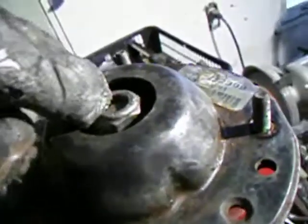Now you're faced with this silly problem that I don't know why car manufacturers do this, but GM's not alone. Here's the top of the strut mount. Get my light back. The top of the strut mount has this shoulder on it, so you can look down in this hole and see the nut that goes on the top of the strut shaft. Right there, it's loose now. I've got it all loosened off, just sitting there. You can see the nut, but it's recessed down in, so you can't get a wrench on it.